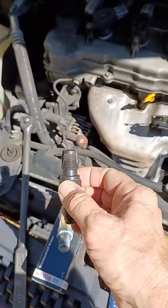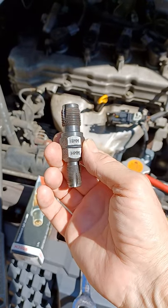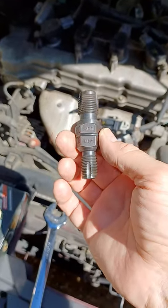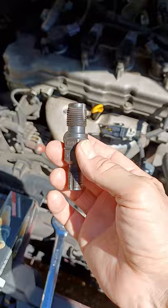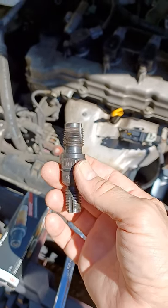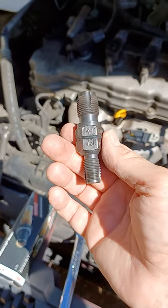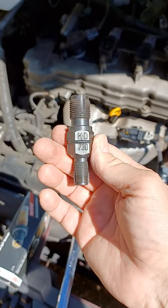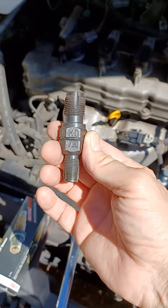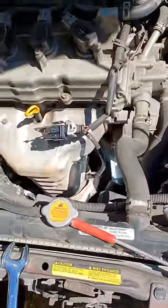Last but not least, you'll need one of these — this is an extra, the hot trick which no one will tell you. In the Bosch videos, it talks about taking a wire brush and cleaning the threads, but the guy uses a battery terminal brush and does an incompetent job. This, however, is a spark plug thread cleaning tool, and it fits the oxygen sensor hole, so it's a much better tool for cleaning the threads. You don't even need a socket — you can just use your hand to get it in there.